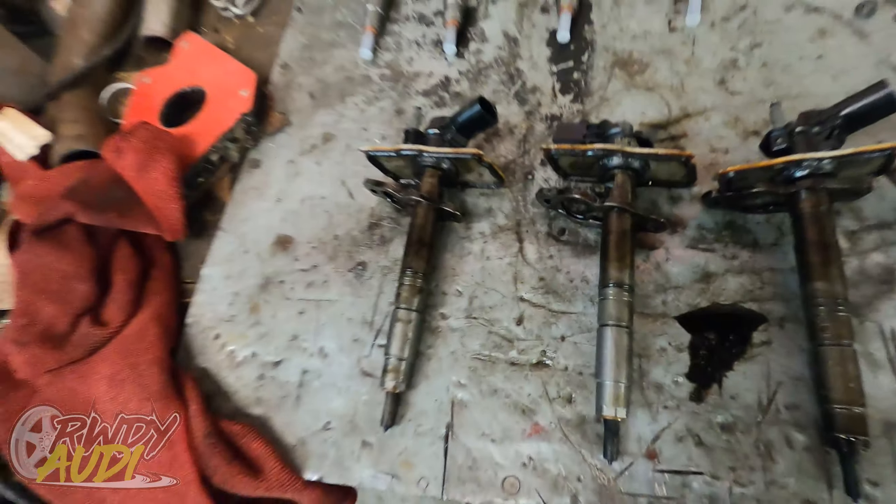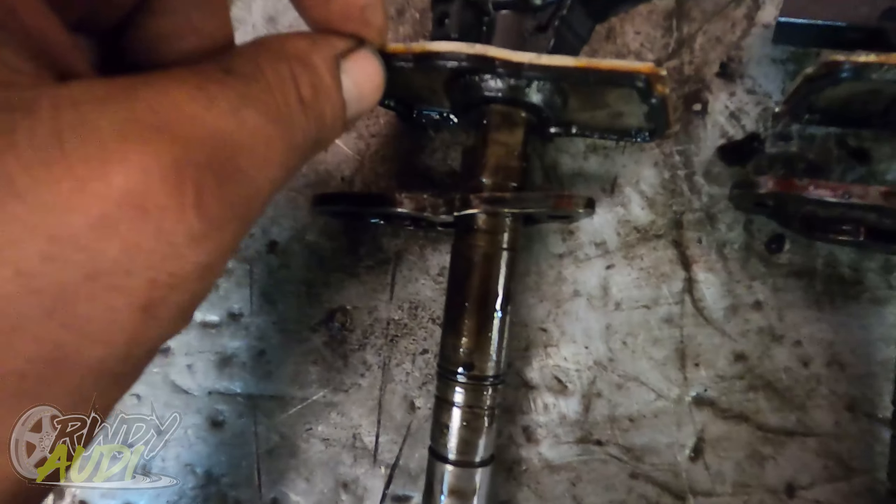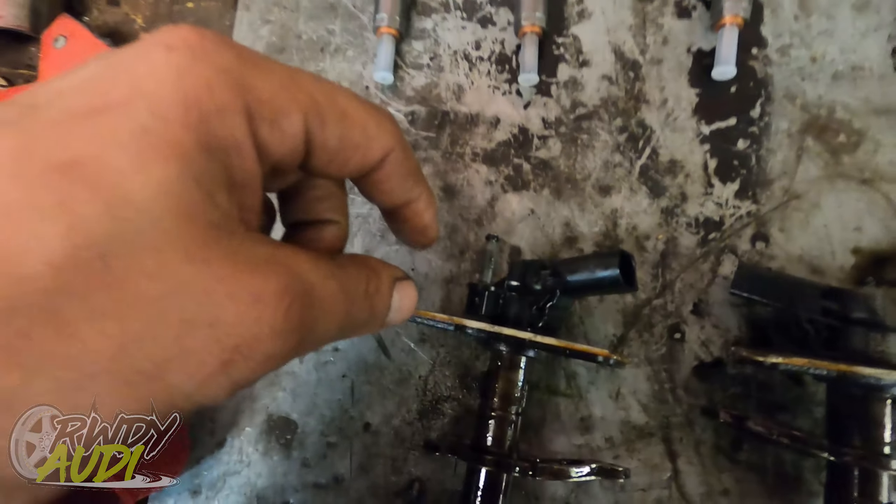We got the injectors out — now what do we do? We got to do a couple things. First, we need to make sure that each and every one has their little copper o-ring on it. Second, we need to take all of these little bands off and make sure we notice the orientation of them because that will matter — that's what actually holds them down and what those 10-millimeter nuts go through. We also have to take these plates off and make sure of the orientation so we can put those on there as well. If you don't, you're not going to be able to get the covers in and you'll have to pull the injector back out — which then you risk ripping the o-ring.